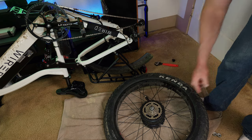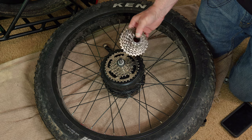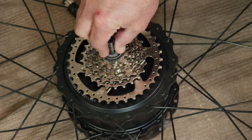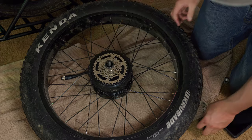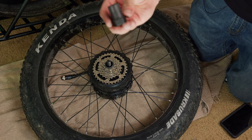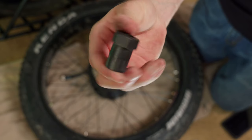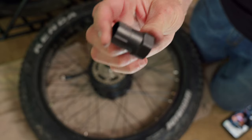The wheel is out. We're going to put it cassette side up. This is already the 11 by 34 tooth; this is the stock cassette — notice how much smaller it is. There are a couple of washers in here you'll need to remove. Once the washers are removed, this is where you'll need one of the special tools I mentioned: a Park cassette tool. I'll put the link in the description — this is only about nine bucks.